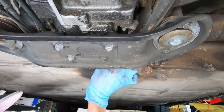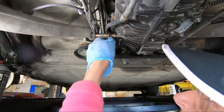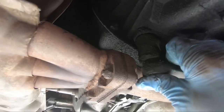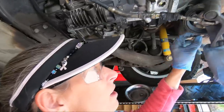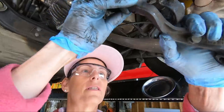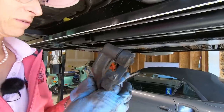Underneath here there's a wire that needs to be removed as well — it's just the reverse switch, just a little plug. Those guys are off just like that. There's a little rubber gasket up there, so you want to keep that in mind. Now we can get this guy off pretty easy — pop, off it comes. Here's our clutch arm and omega spring, but it's all very dirty and we have to clean all this.